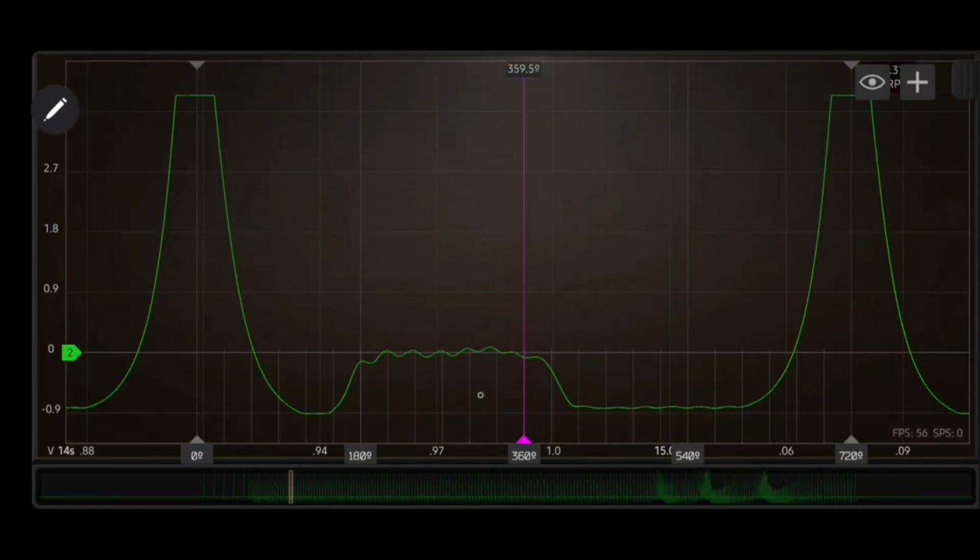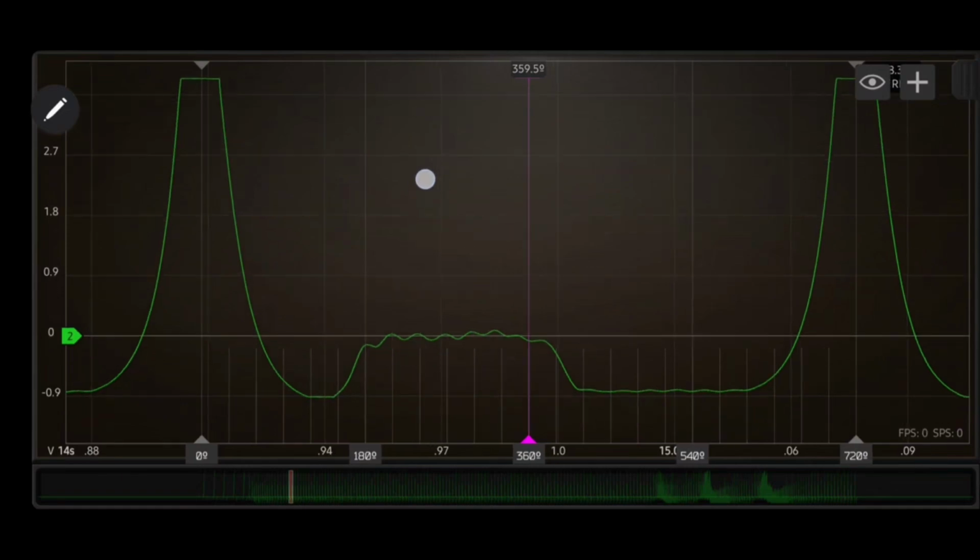Now, down here at the bottom, our exhaust pocket right here, we want to see a point of definition. Like I said, it is hard to see because of my pressure transducer, so once again I do apologize. But you will see this pocket right here, it doesn't really come to a point, but it comes to a place where you'll see a definite change. It starts to rise again. So that point right there, we want to be usually somewhere between 30 to 60 degrees. As we can see here, this is probably right around pushing that 60 degree mark. So this is pretty close to that mark.